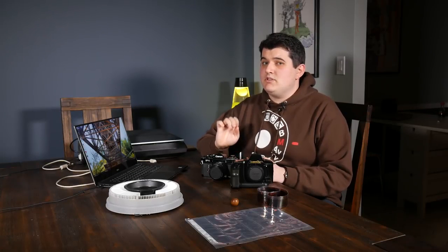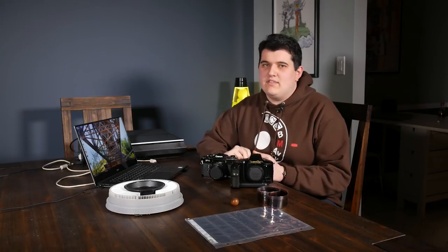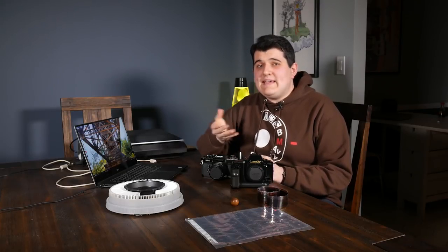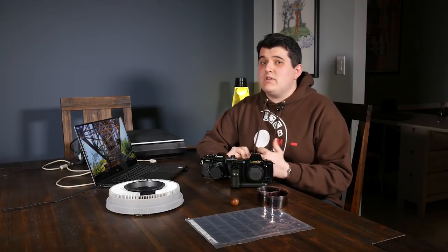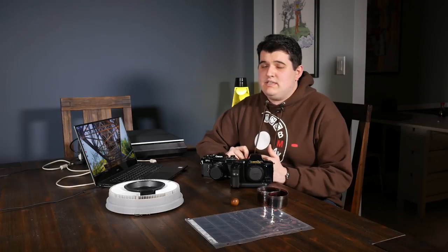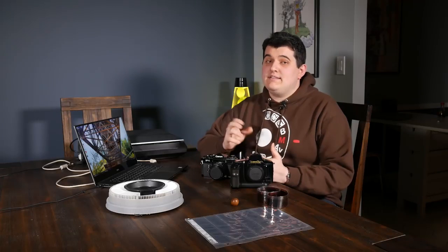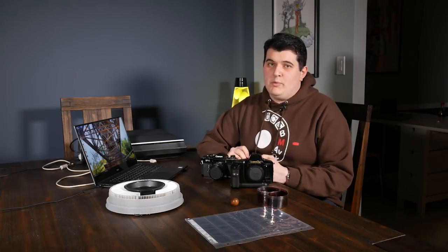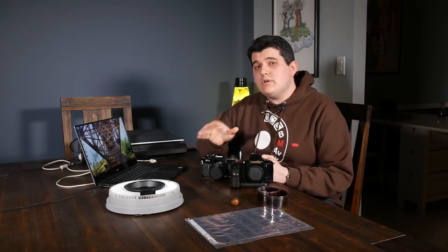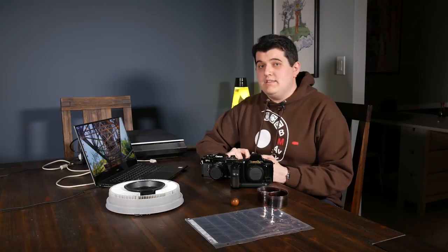Kodachrome slide film also doesn't behave too well with Digital ICE, though it can, depending on the slide. In this case, the cyan dye in the film can absorb some of the infrared light, which occasionally becomes detected as a defect. The scanner might try to remove things it shouldn't, and the results can be weird. I don't have any Kodachrome slides to test this on, as although Simon and Garfunkel tried their best to convince her otherwise, Mama took my Kodachrome away in 2010. However, Google Kodachrome and Digital ICE and you'll see some good examples. I'll link a particularly good one in the description.